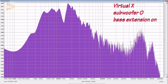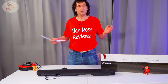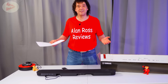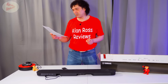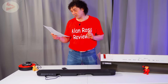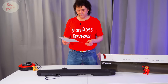Bass extension is basically a waste of time with Virtual X — don't use bass extension with Virtual X; it does not sit well. Virtual X is already doing things with the bass, and bass extension doesn't sit well alongside that. However, when you're in standard mode, it does make a big difference. It's not like using the subwoofer — you're reducing some of the very highs and getting a boost of up to five dB from 150 Hz down. They work slightly differently; you can use them together, just not in Virtual X mode where bass extension won't make much difference.